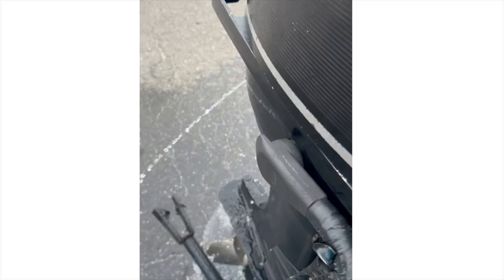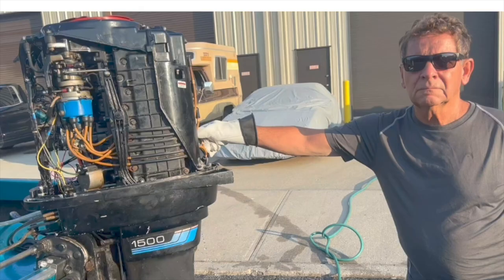The next issue was, even though it ran well and it never died, it still sounded like it was running on 4 cylinders. Wearing electrician's gloves, Peter pulled the wires. Sure enough, cylinders 5 and 6 had no perceptible change. There was spark on 5 and 6, so either the bottom carb wasn't working, or as someone suggested, the lower crank seal is bad, and we wasted a lot of time on this engine.